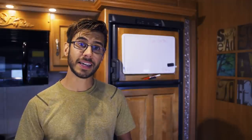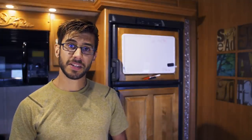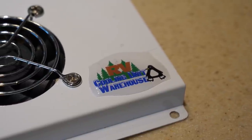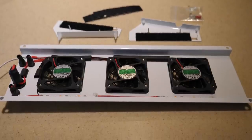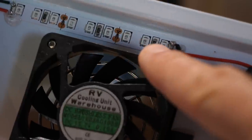You can regularly pull the food out and defrost your fridge fins, or you can add a fan to keep it defrosted all the time. We reached out to the manufacturer of the cooling unit and asked if they had a fan kit — and they did. A fan kit for these fridges is a set of fans that sit in front of the fins and blow air across them all the time, helping keep the fridge a nice steady temperature by circulating air across those fins and keeping them defrosted. The fan unit we got from JC Refrigeration was an RV Cooling Unit Warehouse fan system, though they said they were working on their own in-house fan system. The unit is very simple — just a set of three fans controllable by switches, with a set of blue LEDs that can be switched on or off.